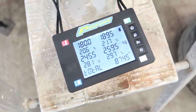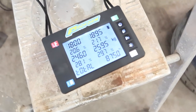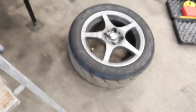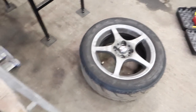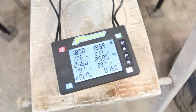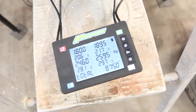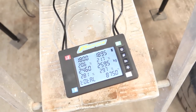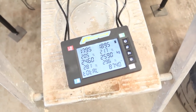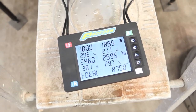The weight without me in it is 874 - and obviously we've got no wheels on either. That's pretty light, isn't it. I've ordered some luggage scales so I can weigh little bits, but they seem to have got lost somewhere between China and here. Maybe we'll weigh it again at the end with the wheels on, just to make sure we're not stupidly underweight from fitting that lightweight battery. We should be about maybe 15 kilos lighter than last time overall. We've got an idea now of the cross weights and they don't look too bad - not perfect, but not too bad.